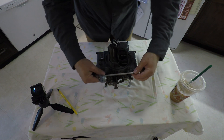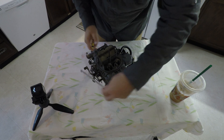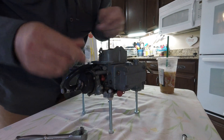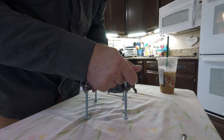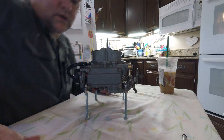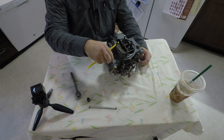There is a part missing here — this actually goes in between into these holes. You can see here it's supposed to go in here to here. When I took this bowl off, I just didn't stick it back in there, that's all. So these are already loose, and they take a five-sixteenths socket. Now, this is where your fuel comes in. This screw here.